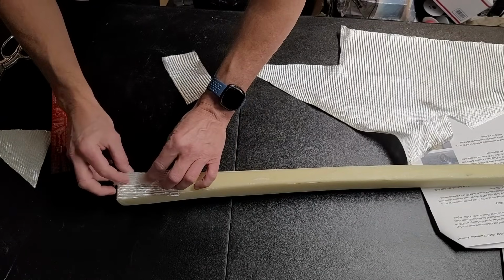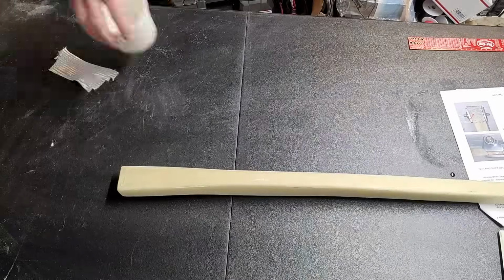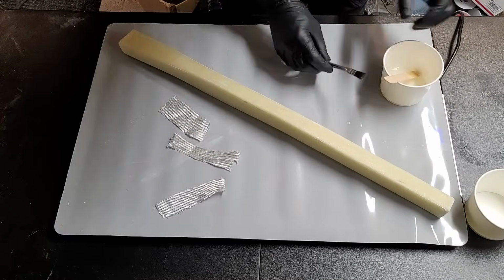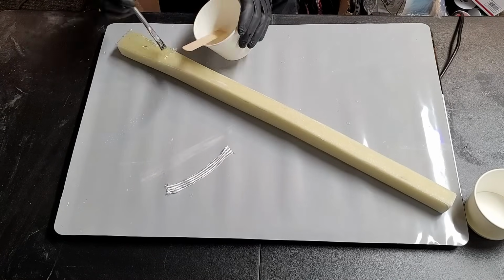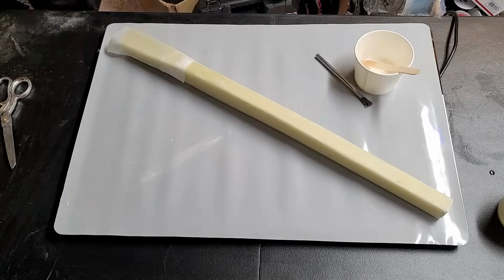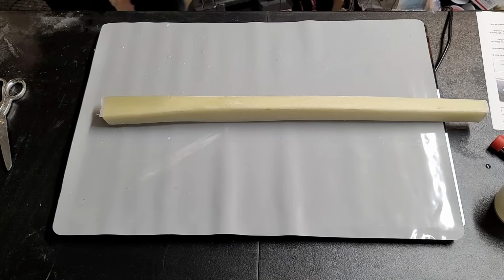So those will be our layers that we're going to be putting on there. This is actually kind of like sculpting. So you take the materials that you're building with, which in this case is epoxy and glass fiber, and you're just laying it up and putting it in and looking at it and seeing where you need to put some more and laying that up. Now I've got some Peel Ply on there, and that should take care of it. And once that's cured, we'll take that Peel Ply off, and then we'll take some measurements, see how it looks.